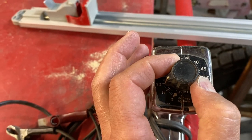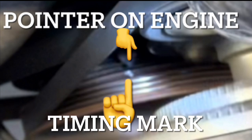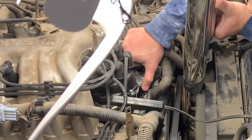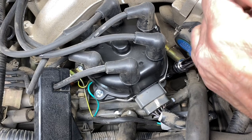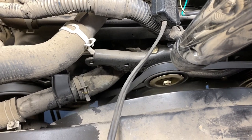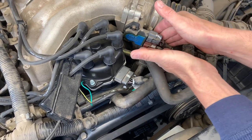Here I've got the timing light set to 10 degrees so I'm looking for the mark I made on the zero degree, and here is a good view of the pointer on the engine going right to that mark on the crankshaft pulley. If you are off, all you would do is while the engine is running slowly rotate the distributor clockwise or counterclockwise to make that timing mark line up with the pointer. Right now we're reading at about 3 degrees, and if I move it back — now we're back at 0. Once you've got your timing set correctly, go ahead and finish snugging that bolt down with a socket. I do recommend checking it one more time just to make sure nothing shifted when you tightened the bolt down. Once you've done a final check, plug your throttle position sensor pigtail back into the sensor and that's all there is to it.